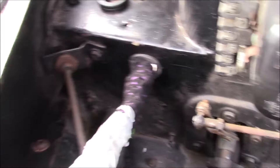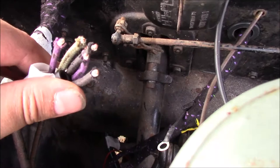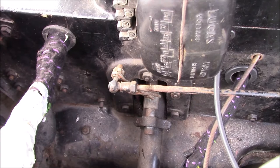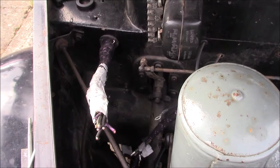That was quite literally painful. This is the problem when you don't have instructions. We had got this one coming through this hole, and it needed to be the other way around — they cannot both go through the same hole. They have to go through separate holes, and this is the route they want to take. The reason this one can't go out through there is because these wires will then be too short to reach the voltage regulator. It's something we didn't realise until after we'd spent ages putting everything in. The original holes in the bulkhead are big enough for this wire — it's a little bit tight where the extra bindings and junctions are, but you can do it.